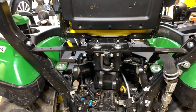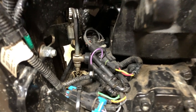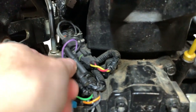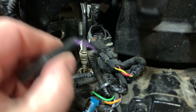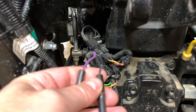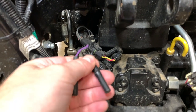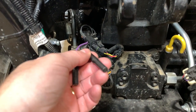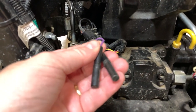From the reading and research I've done, there's a spare set of wires for external lighting. While I have the backhoe off and I was doing my oil change, I thought this would be a good time to look for them and install these lights. They're right here — they had a small zip tie and they're not really secured that well. There's a black and a purple wire, and I'm going to double check — I'm assuming the black is negative. With LED lights they have circuit boards, so you do have to make sure you have your negative and positive correctly.